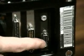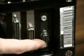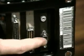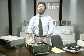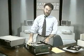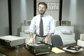This board over here is the display controller board. I know this because it's connected, or it was connected, to the display before I took it off, and because of its connector type. This is a female 9-pin connector, the connector used for the first three kinds of video boards offered in the PC world. Those boards are the monochrome display adapter, the color graphics adapter, and the enhanced graphics adapter. Those names are a mouthful, so they're generally called the MDA, CGA, and EGA.